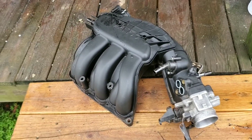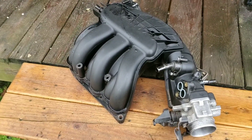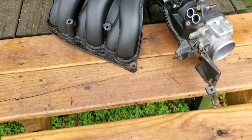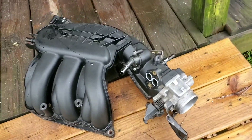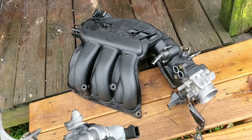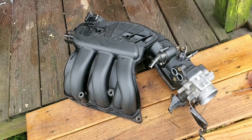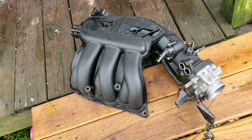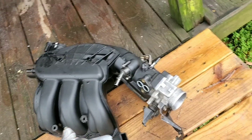I want to take more advantage of the high RPM airflow of the rocker arms and the headers, so I've switched to a 2000 Taurus manifold. This only comes in the year 2000 and is significantly shorter. It's about the same size as the 2002-2003 composite version, but it's metal, so I can put a 60 millimeter throttle body on it.